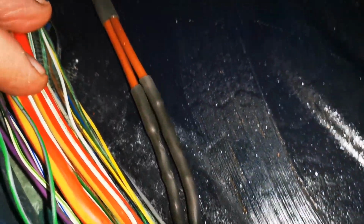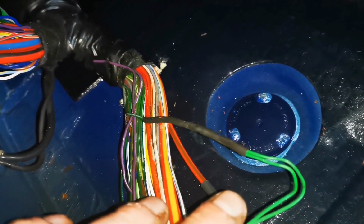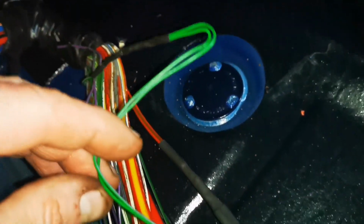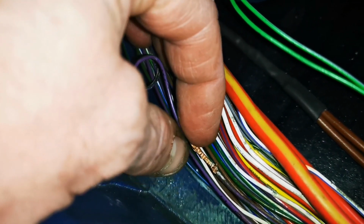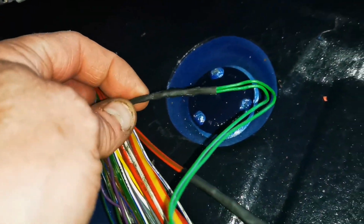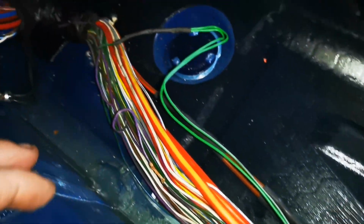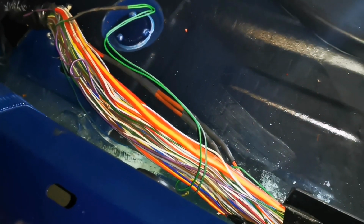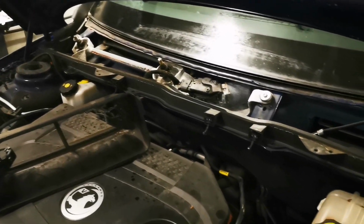Okay, so we've done a little bit of wiring repair here. So we'll have two wires get into one. There, and as our LIN wires, one wire getting into the two, and that other wee one. I'm happy enough for that. Just going to insulate that with vinyl mastic tape, not your ordinary PVC tape. Put a bit of a seal on it. So we need to get that tidied up, bunched up, taped up, what have you, and we've already proved that's the fault.